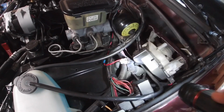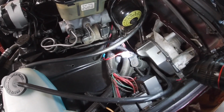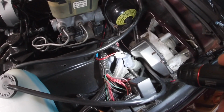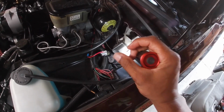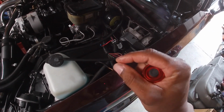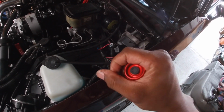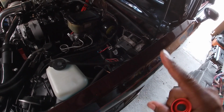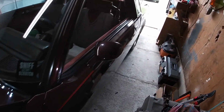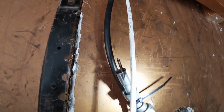So using that same concept here, I just put that electronic vehicle speed sensor right here in its place. The only thing that I had to do was there's a little D-shaped aluminum arm on the end that's going into that hose in there. That D-shape is for you to slide the mechanical tooth gear on that spins with the governor inside the transmission. Well, what I did is I shaved that D-shaped arm down to look like this right here.